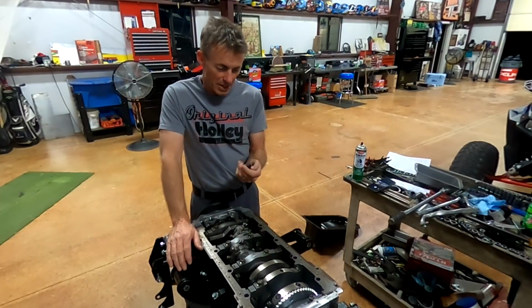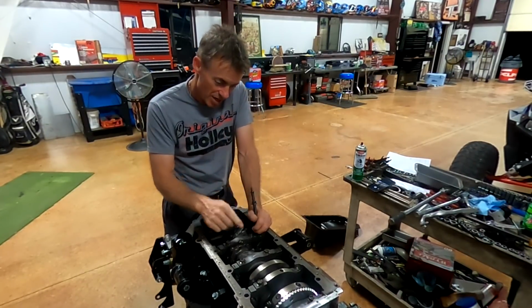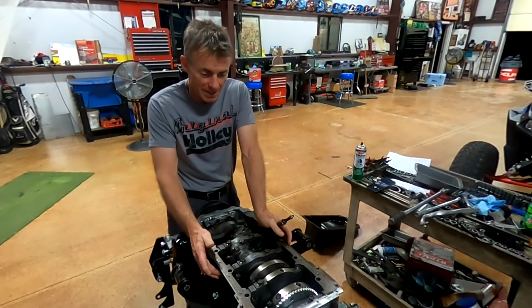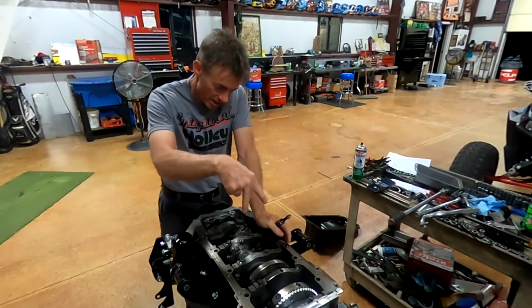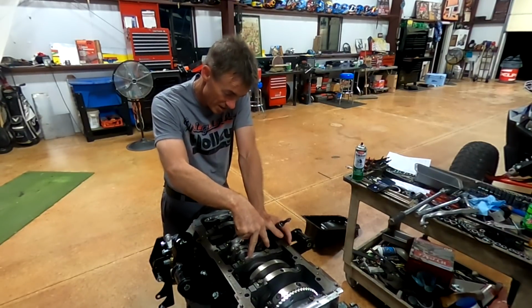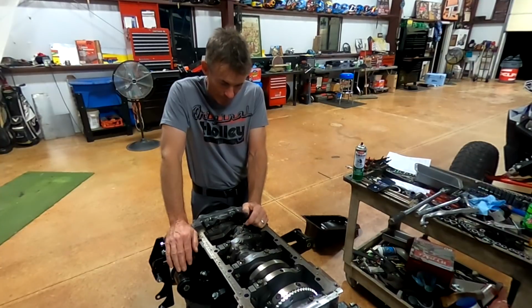Now where I'm probably going to get beat up about doing this is I'm only going to change this one stud. I'm only going to take that one bolt out. I'm not disturbing that bolt, and Hemi has side bolts, and it's really funny to me how close some of this is to the Top Fuel car. The Top Fuel car's got standard billet aluminum blocks, which have two main studs where this has bolts, and it's got side bolts. This is the same way that the Top Fuel motor is in an Alan Johnson Hemi.